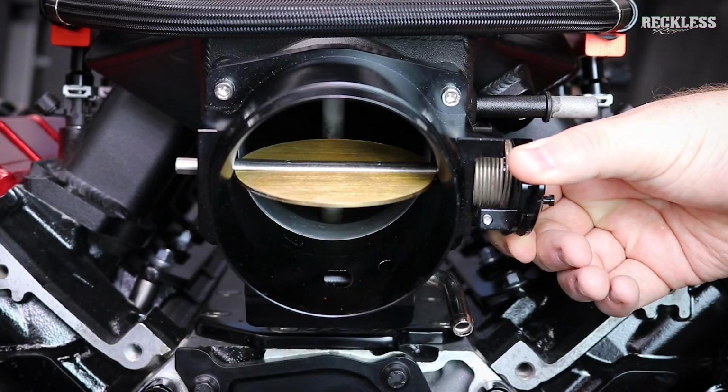There you can see, there's no lip, nice smooth transition. So the engine is ready to drop in. I'm gonna grab the cherry picker. We're gonna get it dropped in place. Once it's in though, we need to position it to make sure it is centered and square. We're gonna use some plumb bobs for that. And once we have that dialed in, we're gonna use a little trick with a laser to make sure that the angle is set correctly.